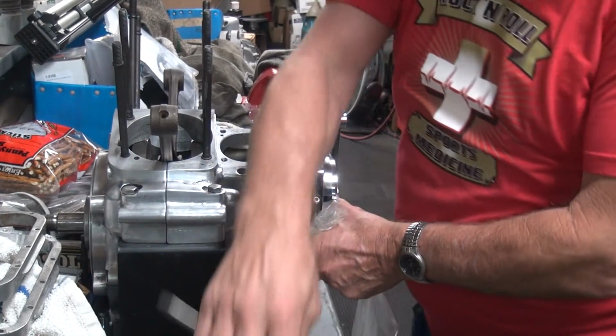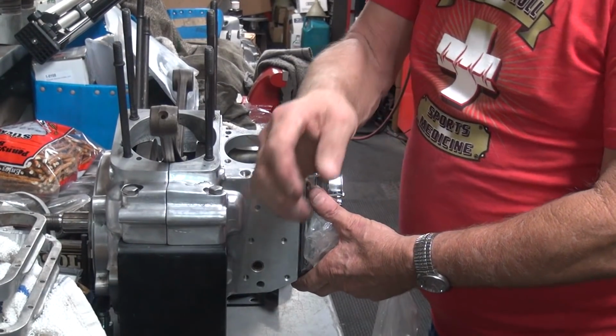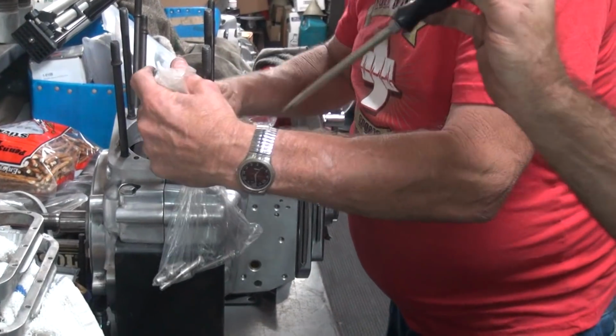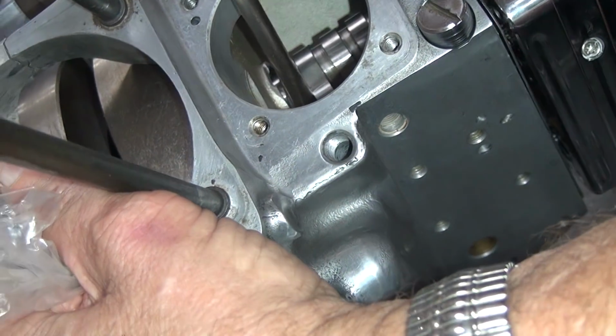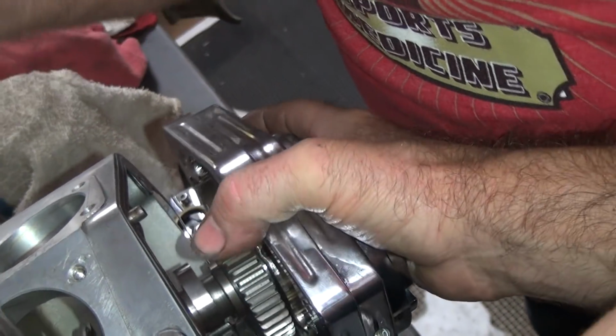No, you don't put that in there, you dumbass. Back of the cam. Big screwdriver. Rotate the lobe until it's where you can get to it. See? It'll bring it around till you get to it. Stick it back in there like that, and pop the cover off. There you go. Now you can go up here and just lightly put it between here. There you go. See, that's how you do it without screwing up everything.